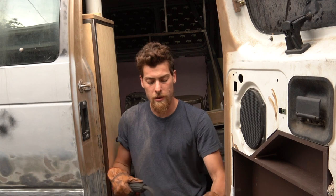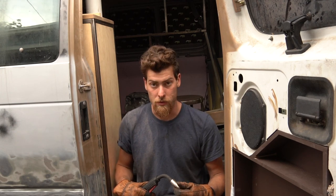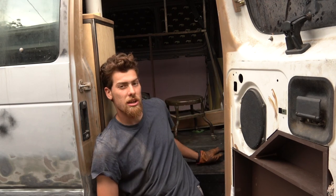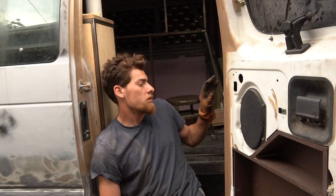I tried to save a little weight and money with this floor, so I got some thin material — I think it's like 16 gauge — because we did replace this floor. The downside is it's so thin that when we step on it, it flexes. I added some ribs out of just half-inch angle, thinking that'll stiffen it up, but the half-inch just bent with the floor.